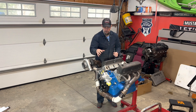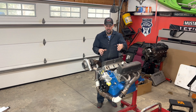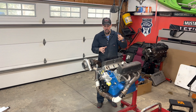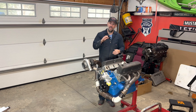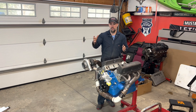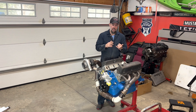I've also got to get some of the front end brackets onto the motor. I just want to check to make sure that we have clearance and everything with the alternator on. I won't be able to check with the power steering pump without the side of the car, but we could also put the AC on and just get that mocked up. Let's just make sure that all clears the turbo piping and everything. Then the next thing is I need to get the Mustang moved over, finish getting the wire harness out of the car, the stock computer, that section of wire that goes from the firewall to inside the car to the computer, because I've got to send that out to MF Customs. They're going to modify all the harnesses for me so I just have the stock gauges still working, the AC is still working, all that kind of stuff.